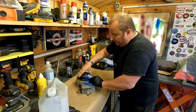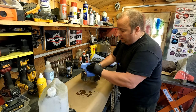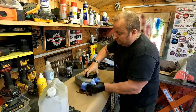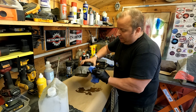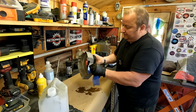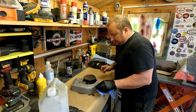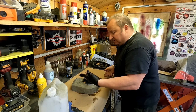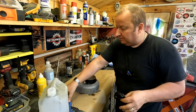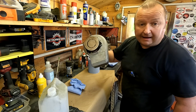Now, I don't think it's as crucial with tin as aluminium, for example, that you preheat this, put it in the oven and preheat it. Or what I normally do is take the blow lamp to it just to bring out all the surface impurities before I actually do powder coat it. But I'm not going to do it in this case, as I say, because it's not aluminium. Right, okay, so that's that. Oh, look at them bloody gloves. Look, cheap crap gloves. Unbelievable. Right, so let's hang this up and give it some powder coat, black gloss.